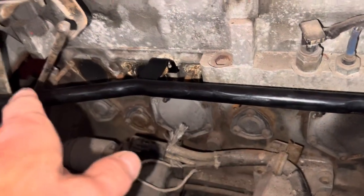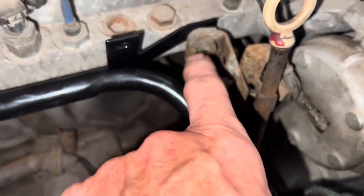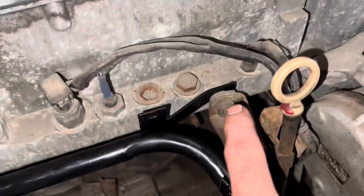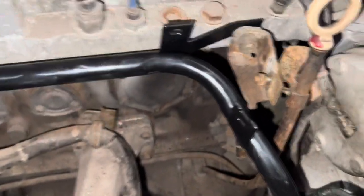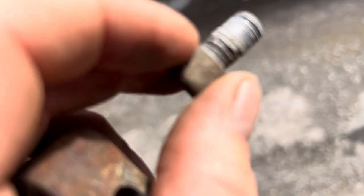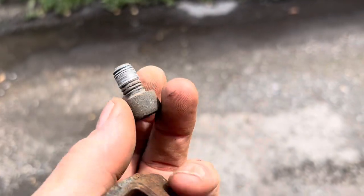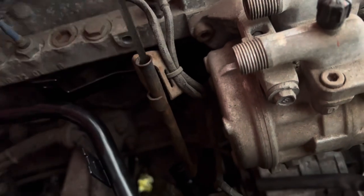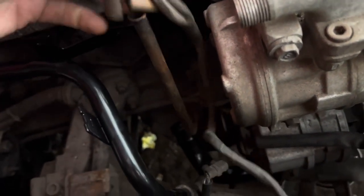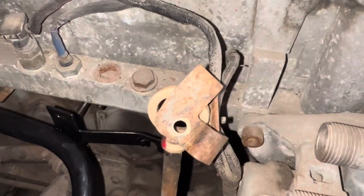As I've mentioned before, when you put a new part or refurbished part on the car, everything else by comparison will look rubbish — so we'll be taking all these brackets home and cleaning them up to the best of our ability. It's not our intention to do a full nut and bolt restoration, but once you start it's sometimes difficult to stop. Just about to refurbish this and noticed the threads are really knackered on this bolt — but in actual fact it looks like it's been helicoiled, so we'll probably have to re-helicoil the block. Just make a note of how this bracket attaches and very carefully snip those without snipping the wires.